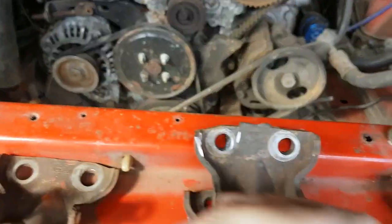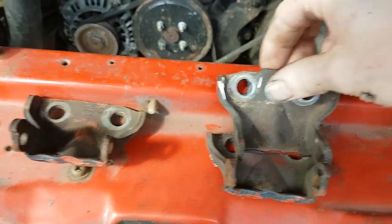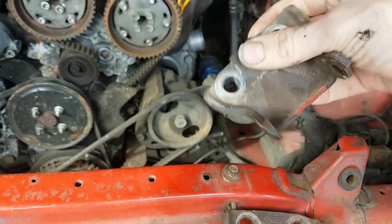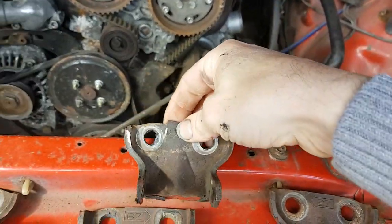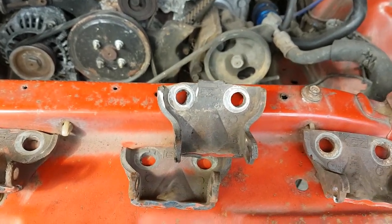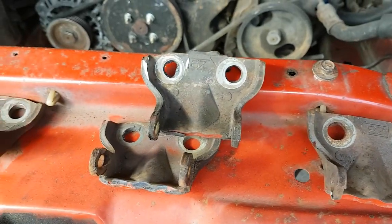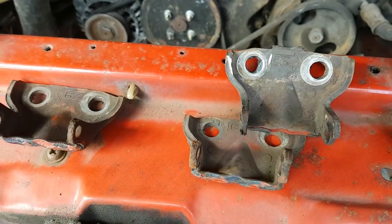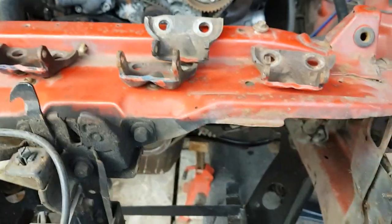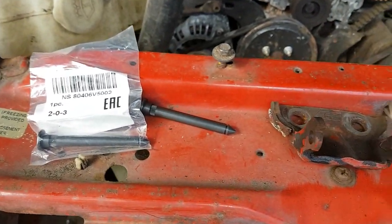That one is not going to be any good. The left and right door hinges are actually the same but they're reversed - you just turn them, swap them round. Lower one goes on the upper on the other side, upper one on the lower. So it doesn't matter which side door you get them from, as long as you get a pair from each door. First job is to find which are the best two hinges and get these pins fitted.